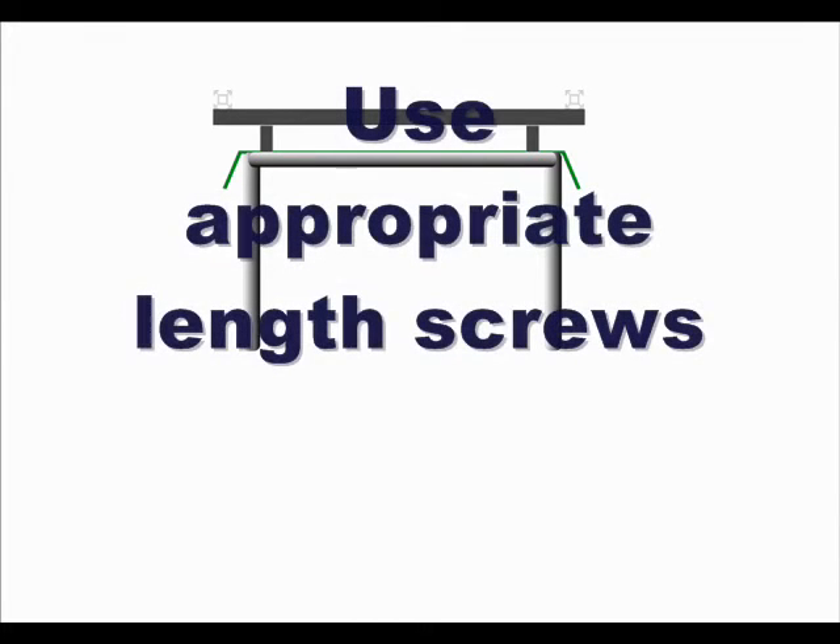The only additional mounting materials are a couple of aluminum rails of the same length as the solar panel. You must place on top of each of the cross bars that hold the roof of the golf cart two 3-inch spacers made from 1-inch diameter square pipe. Then, another length of the same 1-inch pipe with a length equal to the width of the solar panel. Next, the two aluminum rails must be held with screws at the two ends of the 1-inch pipe we just installed.